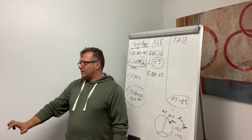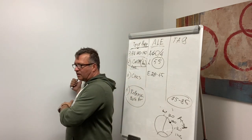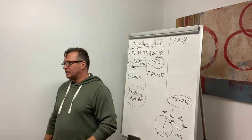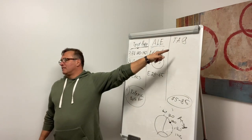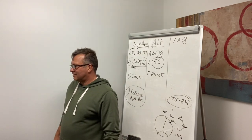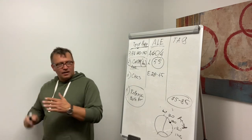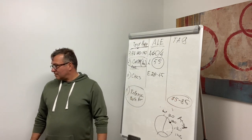When you're releasing the brakes, you're supplying air pressure into all the hoses, right? All your air system. It opens the brake chamber, every single one. So you're losing at least 15 PSI just to release the brakes. When you push the brake pedal, you multiply it 2-3 times. You're losing another 15-20 PSI. And in 60 seconds, when you release the button, it will stay the same. It's not going to go up. The pressure, so that makes it 85. You got it, right?